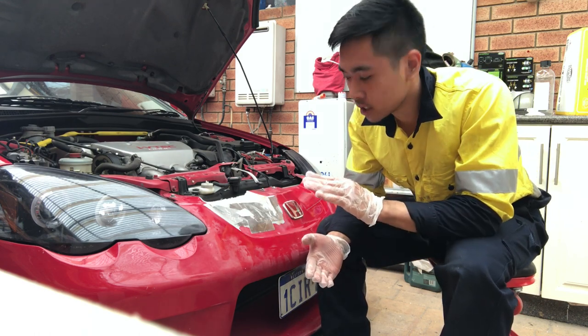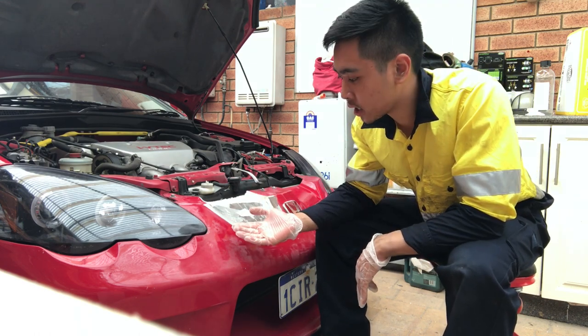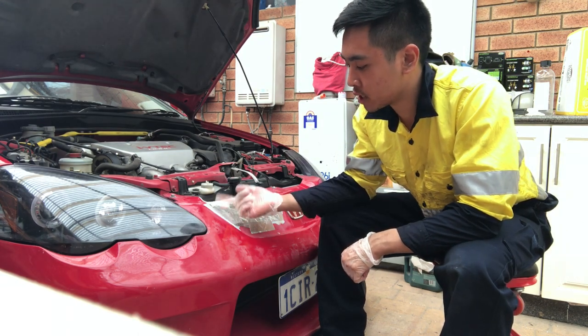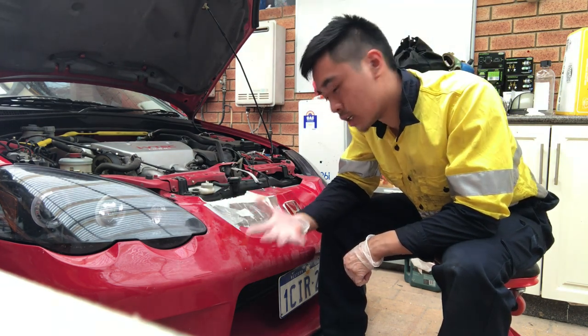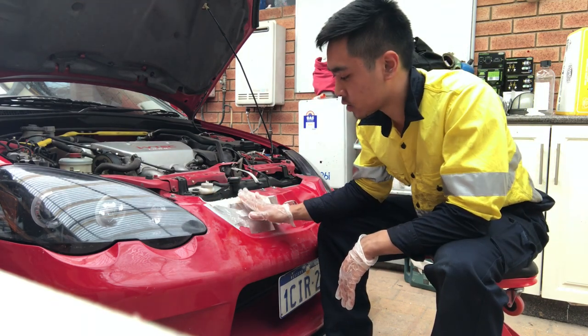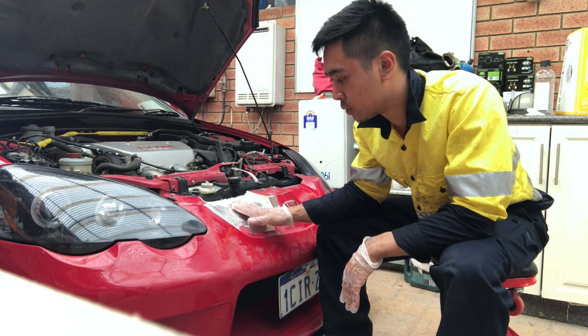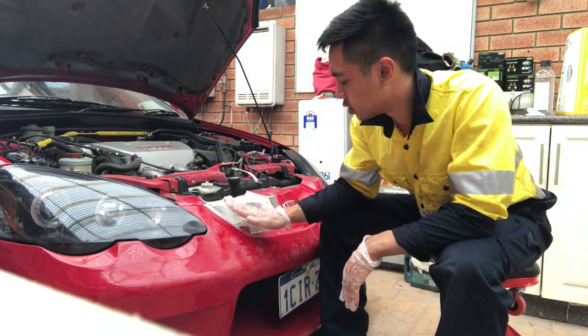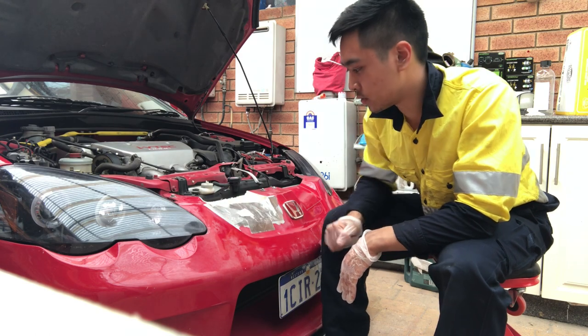Between the fiberglass and the aluminium tape, I'll be adding a releasing agent that will just help the foam and the tape rip off the back side of the bumper. I'll be only adding about 1 or 2 layers of fiberglass on top, and then I'll be working from behind just so I don't build up so many layers of fiberglass on this top surface.